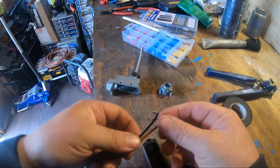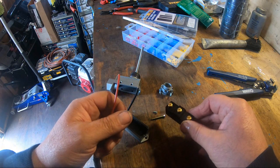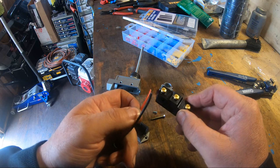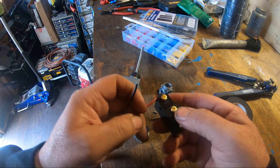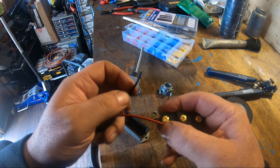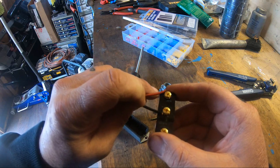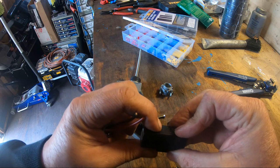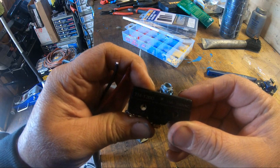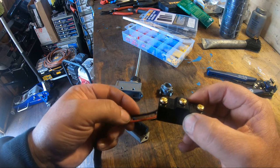My camera died but this is the switch. I'm thinking I'm gonna run to the common and — I may be doing this wrong — but I'm going to put juice in here, and I think the normally open contact is going to be here. When that little toggle switch goes and hits this button, it closes the switch and completes the circuit, which should turn the buzzer and the light on in the cab.